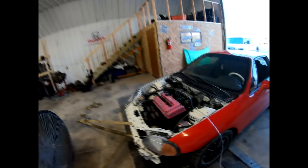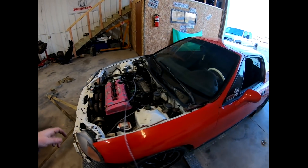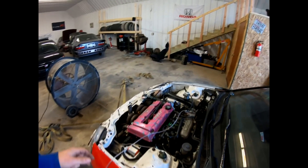We have done a few things to this car when it got dropped off. We fixed some idling issues — I made a separate video on that. We also swapped out the fuel injectors for a set of flex fuel style Hunter Tune injectors, did a valve lash, drained out all the pump gas, and we are going to be tuning this car on E85 with a Neptune Demon. With the Demon board in the ECU, you can use HTS or Neptune. This guy wanted the tune to be a little rowdier, so we're tuning on HTS for the popcorn mode and big fireball pop and bang in two-step.